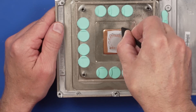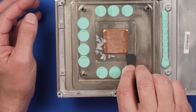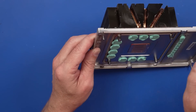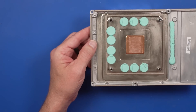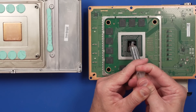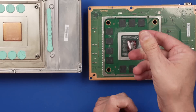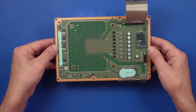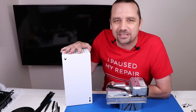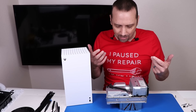Now let's prep this heat sink for the new thermal paste and make sure the correct amount is on here. The place where the actual die sits is all copper, which means the heat pipes probably connect right to this copper piece. With this cleaned up and the perfect amount of thermal paste applied, we can install the board onto the heat sink and put this thing back together and actually play it. My favorite part of the whole teardown is the fact that so many parts are interchangeable with the previous model, making this a pretty repairable Xbox.